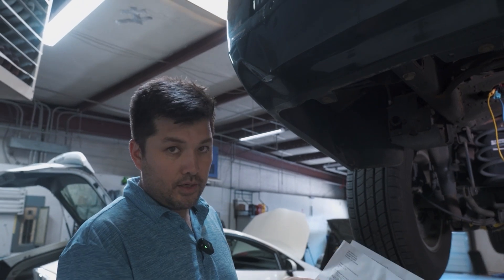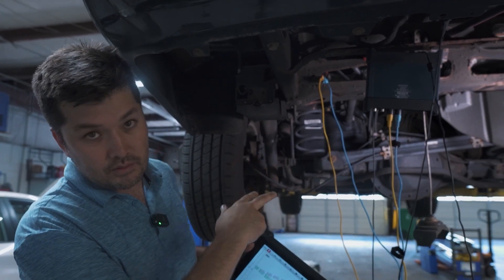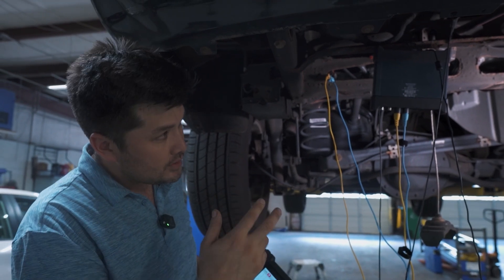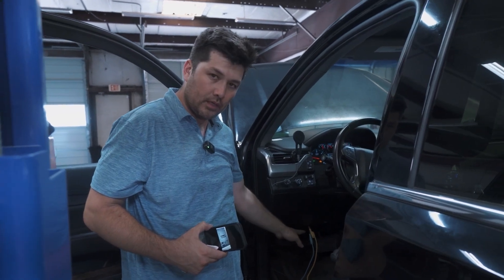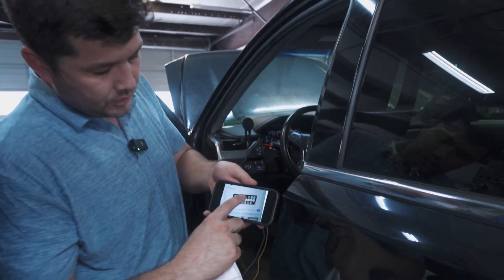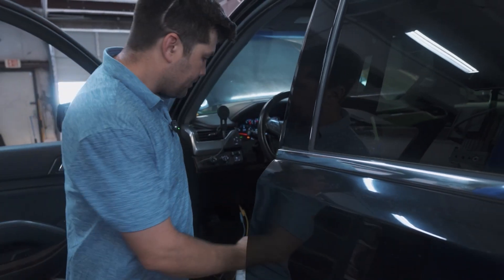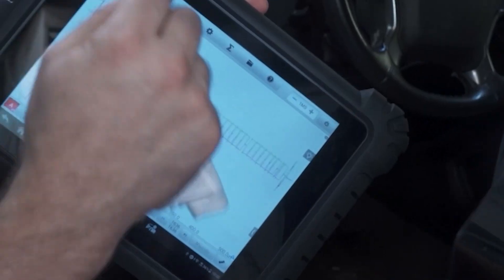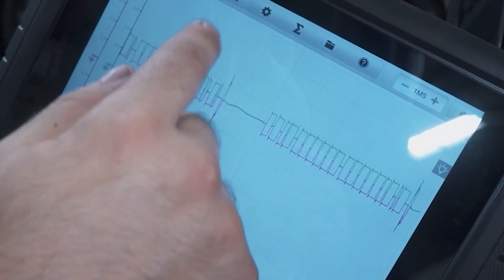I went to the data line wire in ProDemand Mitchell1. If you don't have a subscription, we can give you a subscription. I'm going to connect to the DLC, or OBD connector. We have two CAN bus communications in the DLC. On the OBD connector, pins 6 and 14 are the CAN bus high and low. I'm getting the high and low bus communication. I'll stop it — you can see how they mirror each other, going up and down. That's what a good CAN bus communication looks like.